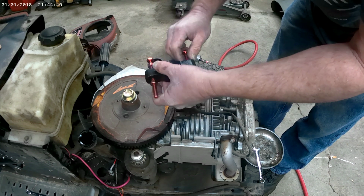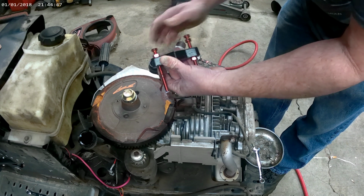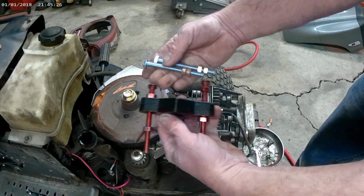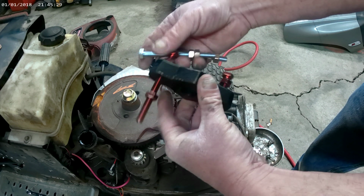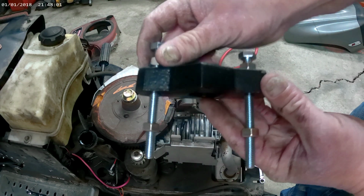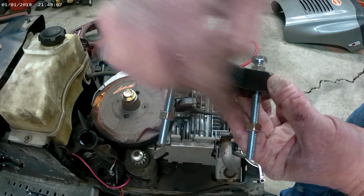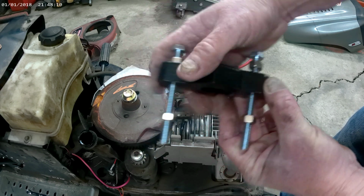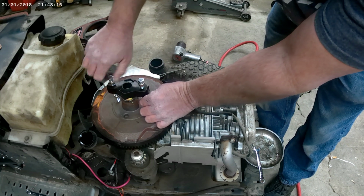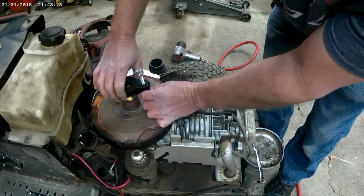so you just have to check the bolts before. I just throw these in it, and of course it's the wrong ones, so let's get the right bolts. These are the 2 sets of bolts that it comes with. It comes with the red ones, and that comes with these zinc coated ones. The way that goes is one nut goes above the puller and one nut goes below the puller on both sides. And then you're going to screw this down in the flywheel as far as the bolt will go, to make sure you get all the threads you can down in there.